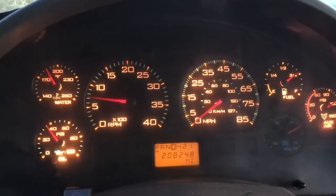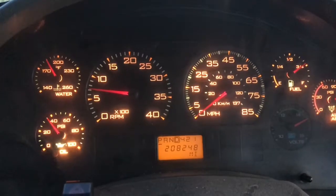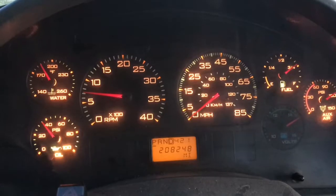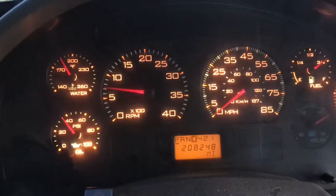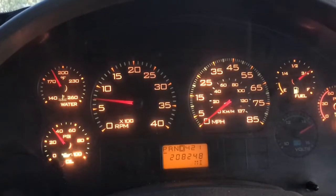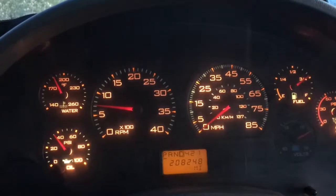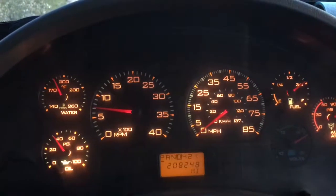It's been two days since I took my fan clutch off and set it back two marks. I think the center mark — the original mark — is actually 215 degrees, so if you go back two marks that should put it at 195 degrees, if I'm not mistaken.